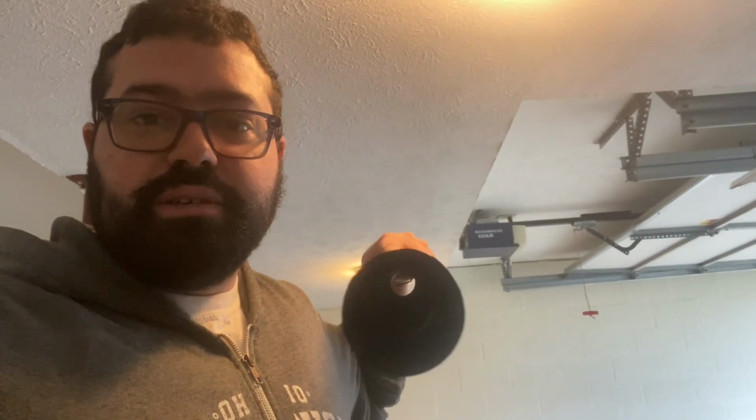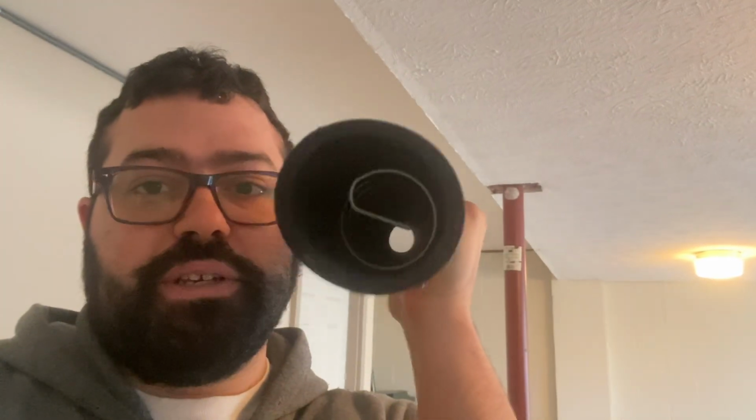So basically what we're gonna do is put these nicer ones on, that as you can see inside them, if you can look closely, they have a steel spring core in them. So these things are gonna handle a lot better under pressure, because they won't collapse. Look, I can't even close it. Those things are strong. I'm pushing with all my might on one hand, and it won't collapse. Those will collapse in one hand, those will collapse with two fingers, the hoses that are on it.